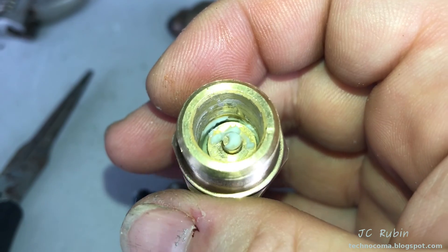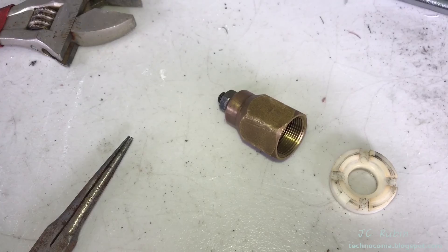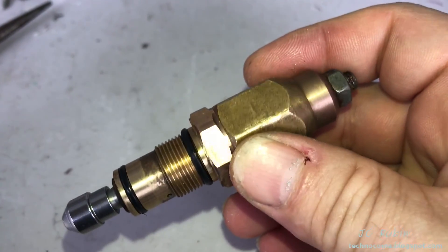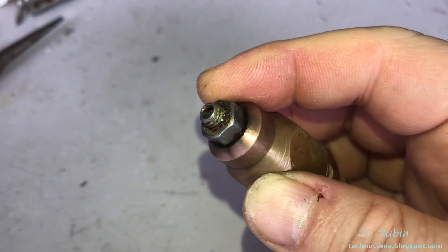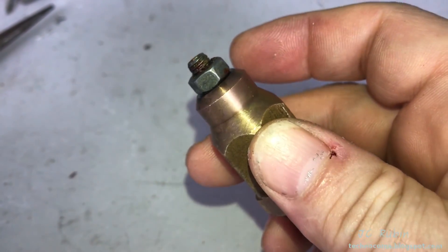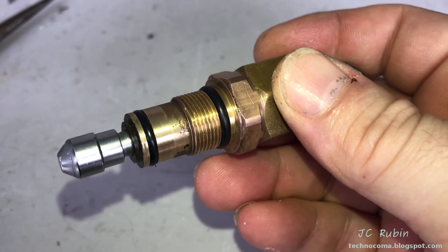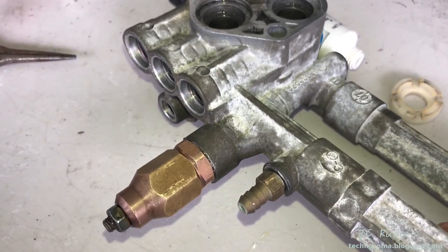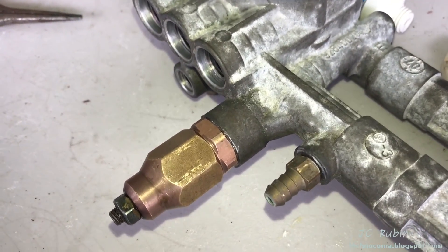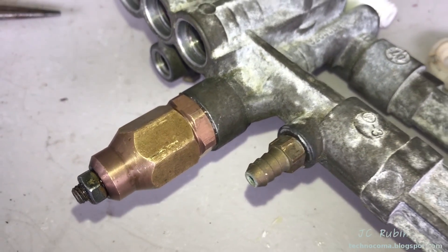Cut the first plate in facing up like this, drop in the spring, drop on the second plate, then screw everything back together. I screw it until it's fully seated. I felt no need to remove or adjust the set screw, so it's sitting exactly where it was. Now I'm going to put some 327 on these O-rings. This is now ready to go right back in the pump assembly. I'm pretty much screwing the stuff in by hand and then just tightening it with a wrench. All the threads are nice and clean, nothing is binding at all — it's like working with brand new equipment.